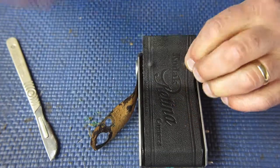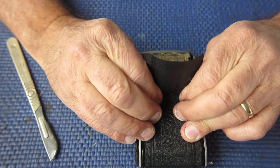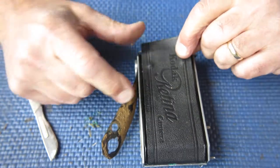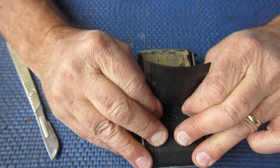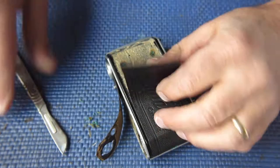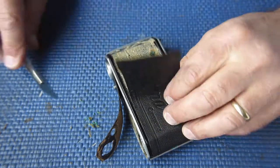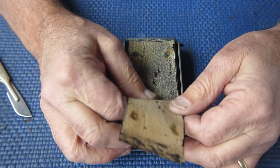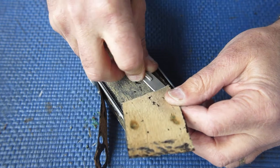The reason I'd like to peel it off completely is that when you go to glue the leather back down, if you stop partway, you'd almost inevitably end up with a visible line across the leather where there was a change from where it was originally glued down to where you've re-glued it. Now I'm just watching the edge of that leather there because it looked like it was tending to come apart a bit. I don't want that.